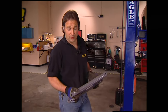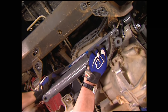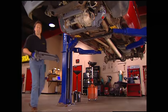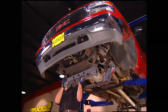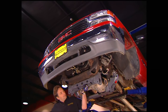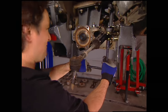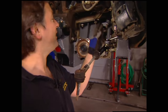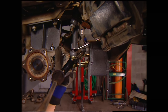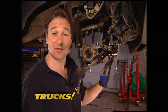Your steering controls are going to have to be lowered, so first thing we'll do is put on this drop link that bolts to the pitman and idler arms. Then we'll mount this new front cross member up to these front lower A-arm pockets, and finally bolt on the stock drag link. Anytime you've got this much of a steering drop, it's going to flex on you unless it's supported. That's what these little rod ends are for — they connect the steering linkage to the front cross member and keep it from flexing forward to back, while still allowing it to rotate left to right.